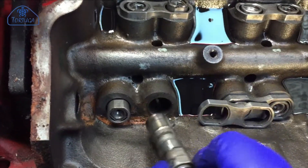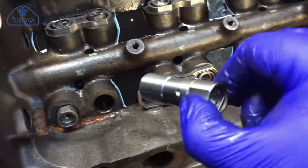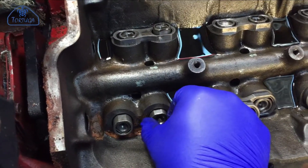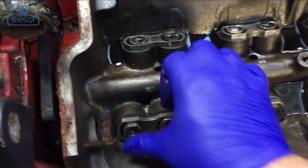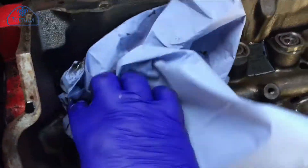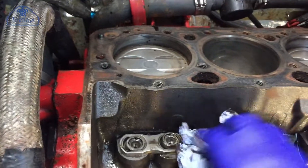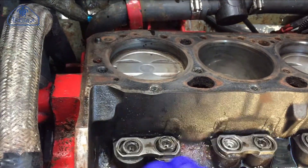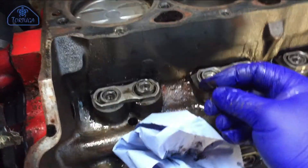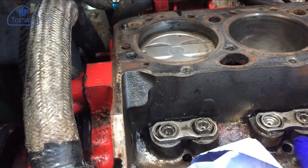It's a repetition of the same procedure for the other valve follower. With the new valve followers in place, just using a piece of paper towel, removing all of the gunge and congealed oil that's been sitting in the valve valley since the engine rebuild started. During this cleaning, I found both of the remaining pieces from the valve retaining clip that had fallen out of the hydraulic follower.